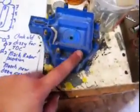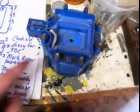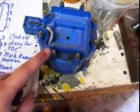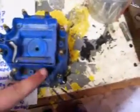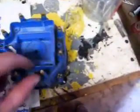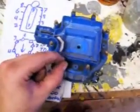So you'd want 1 to your first cylinder. Your second wire would be 8, which would go to your 8th cylinder in the back of the engine. And you basically run them just like this diagram. As I said, any of these can be 1, wherever you want to start it at. On mine, I have 1 over here. That's just the way I set my 327.